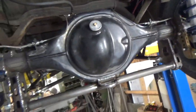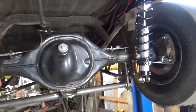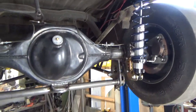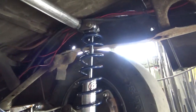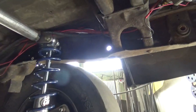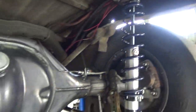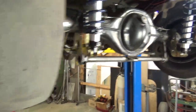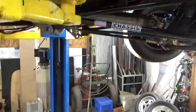But I get this thing in here and it's like every which way. This thing's got baling wire on it, and you can see the way the wiring and stuff is run up in the truck. We had to work around that. It's got a piece of 3/8 fuel line from the fuel pump all the way to the front. NHRA says 6 inches of rubber line max.